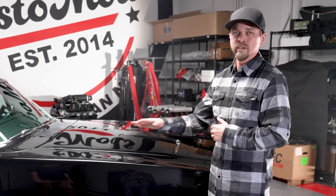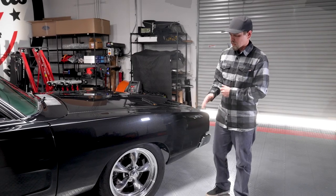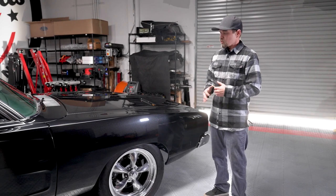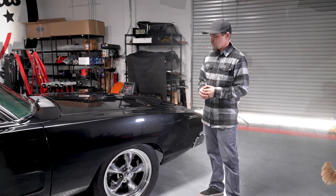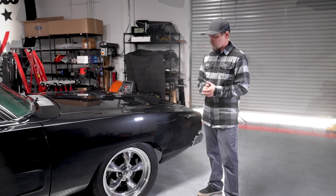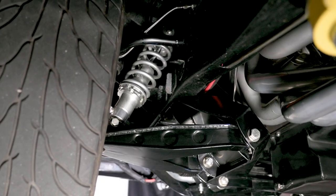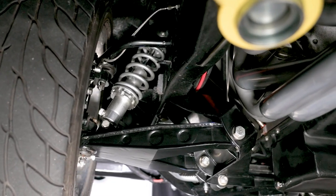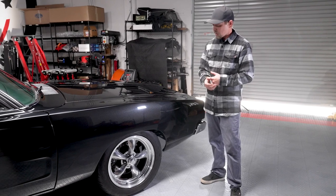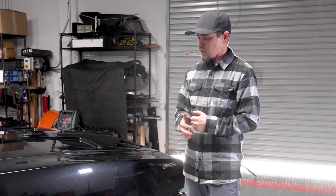When you're putting down a lot of power, you need to upgrade everything around the car to match it, so that's what we did with the brakes and also the suspension. From the factory, these cars had a torsion bar based front suspension, which was adequate in the 60s, but we really wanted to bring this car up to modern handling standards and safely manage the power we've got. So it has a Magnum Force front K-member, which includes fabricated lower control arms, tubular upper control arms — it's a four-arm setup now — coil overs in the front so you can really dial in the adjustability and ride height. This integrates a modern rack and pinion and a bigger beefier sway bar, so this thing doesn't have that tuna boat feel anymore that you get from some of these big body Mopars with their original suspension.